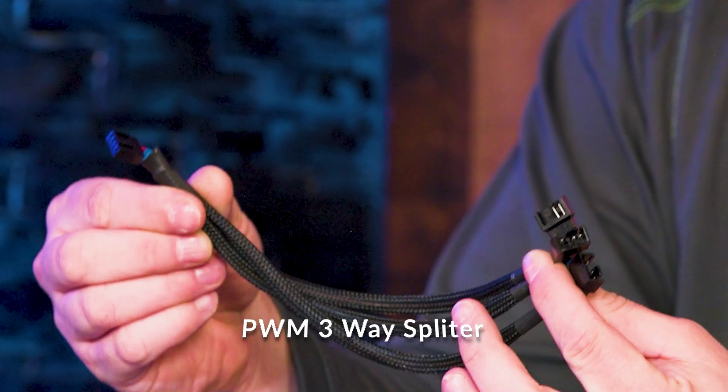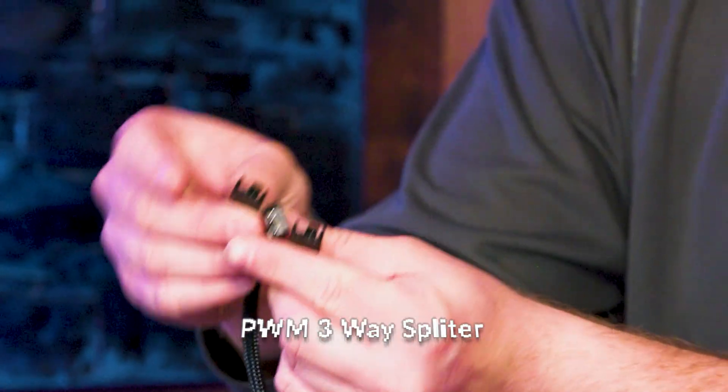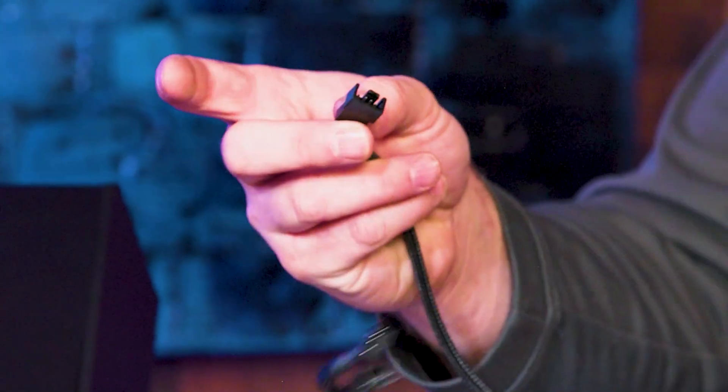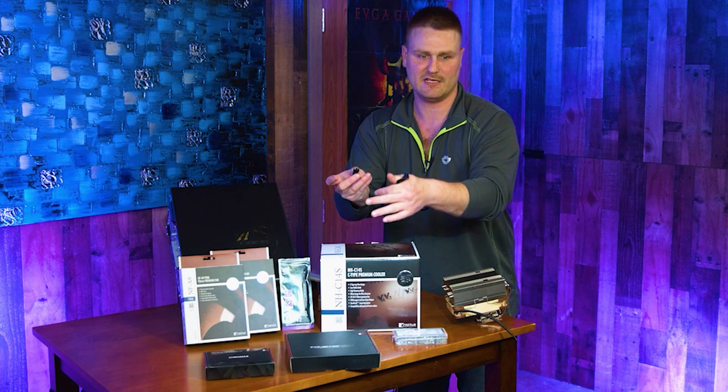You will see where this goes in the install. This is going to go to the CPU fan pin — there's going to be one that has four pins. This has to go to your CPU fan so it reads the RPMs and notices the fan is still running. Your upgraded fan is going to get the one with the three-pin — just an FYI.